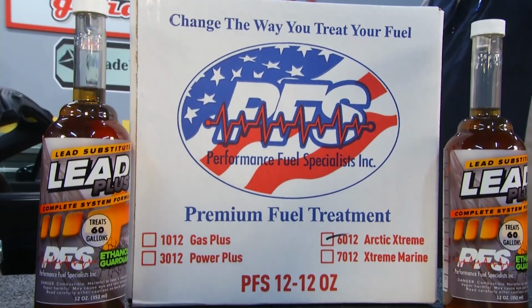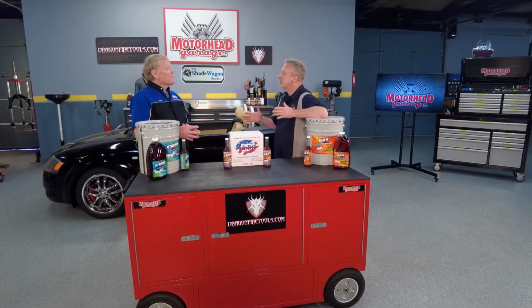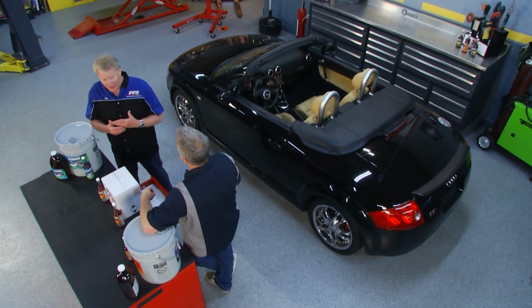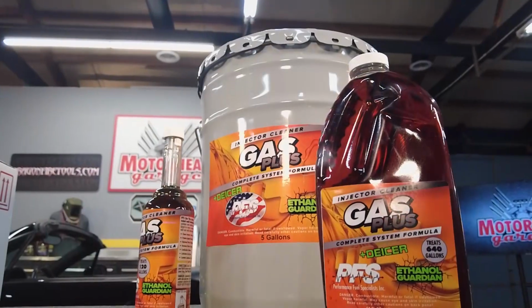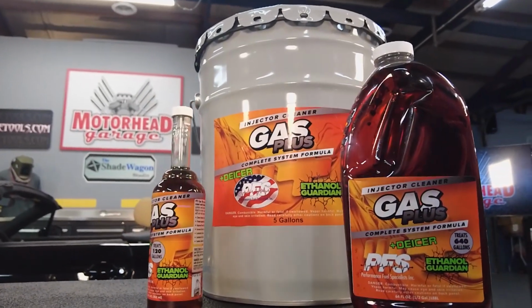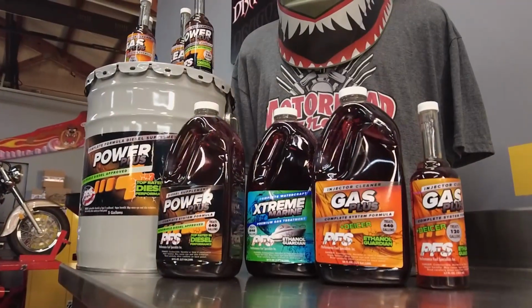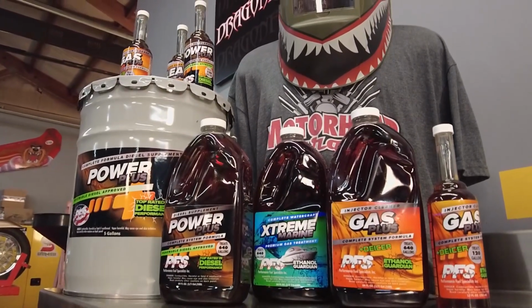There's limited supply. You've given us a whole lot of great information. What's really the bottom line? What do people really just need to know about fuel treatments? They need to know that things have changed. It is not the way Grandpa did it. The fuel, the engines, everything has changed. You need to take care of the investment you've got in these engines. Very expensive. Treat it every time, lubricate it every time, take the water out every time, protect against ethanol every time. You'll get far more out of your engine, far more out of your fuel economy. It's a win-win all the way around.